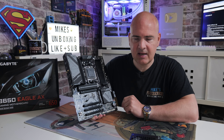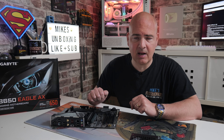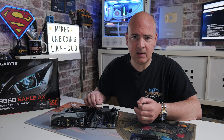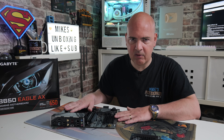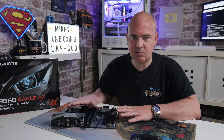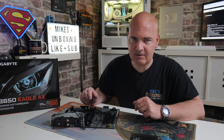Some things you're going to need: obviously the motherboard itself, and you'll also need something to put it on — I'll be using the motherboard box as a stable platform. If you've got this built into your PC already and it's not booting up because it needs a BIOS flashback, you can flash the BIOS within the case itself, although you may find it a little bit difficult to get to the BIOS flashback button, and potentially other components in your system could be preventing the flash from happening. As I always recommend, if you can, do the BIOS flash on a bare motherboard — that's going to be the easiest and least problematic way. But if you've got a fully built system, just go for it, though if you are having problems, you may have to start taking things out of the system anyway.